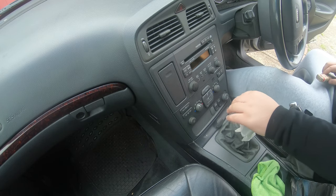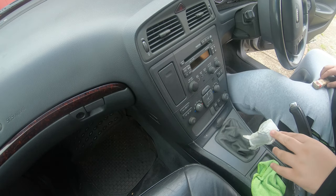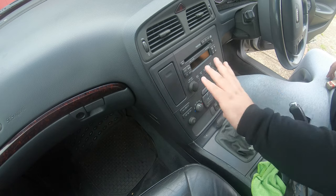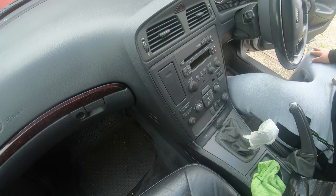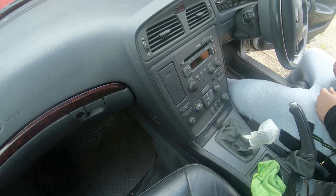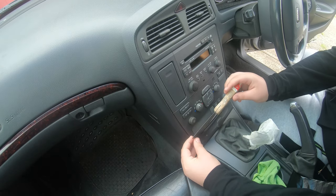To make life easier, I'm going to put it into low gear. Important warning: if you take this out without disconnecting your battery, you are going to trigger an SRS message on the dash. So if you don't have any software to clear your SRS, disconnect your battery. Because I have the software, I'm not going to disconnect mine. First, be careful not to scratch the interior.